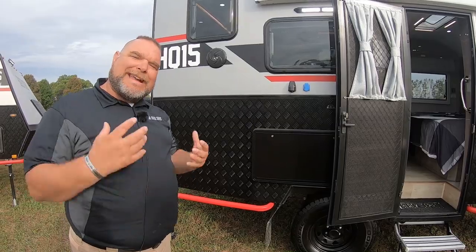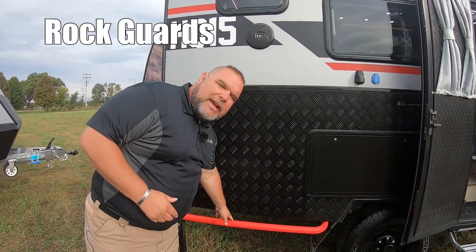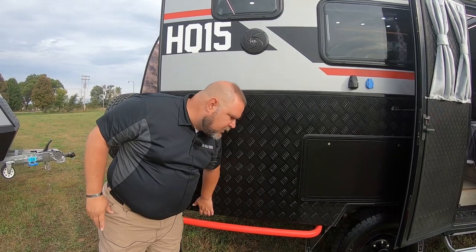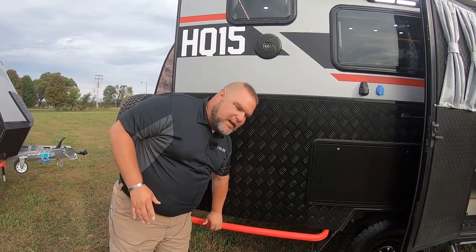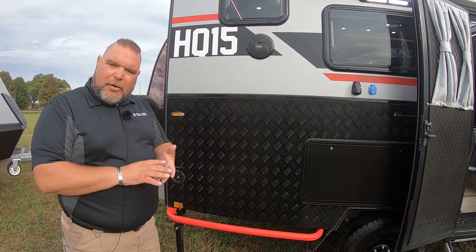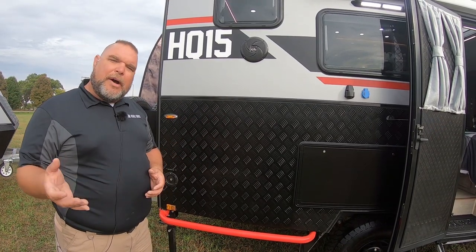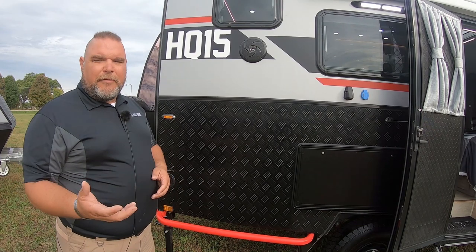To help protect the edges of your unit off-road, we have rock guards — large bars mounted at the base. If you're going through a deep area and that bottom wants to bottom out, you're going to hit your rock guard, which protects the edge of the unit. The bracket might fail, but at least you're failing on that and not on the edge of the unit itself. Similarly, our gray and black 26-gallon tanks are protected with a bash guard — not the heaviest duty, but it gives you a level of protection and it's not an exposed tank.